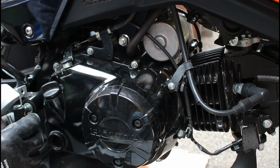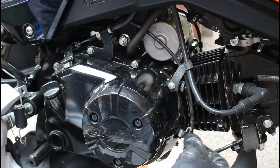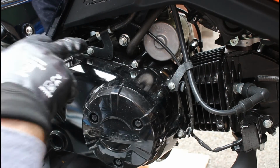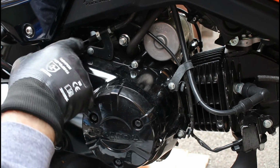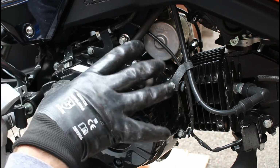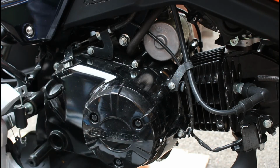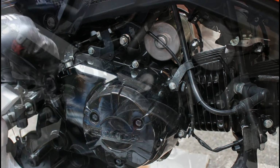So having removed this out of the way, I've removed that electrical cable, by the way, just out of the retainers, so it's no longer in there. I'm just going to crack off this one and this one, but also crack off this 8mm here to then loosen that cable, so that's out of the clutch part of the system, so then the casing can come off without anything else being attached to that casing. But as I always said already, don't forget to remove the dipstick as well.